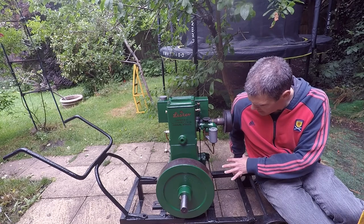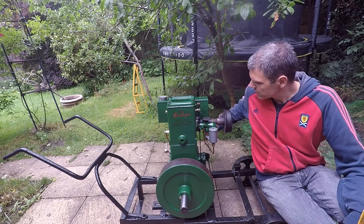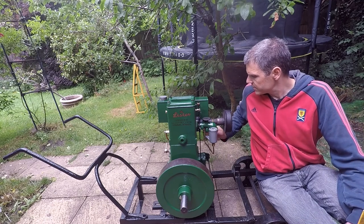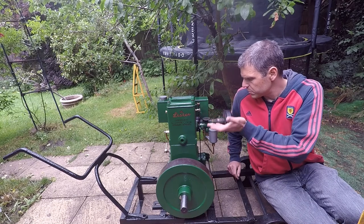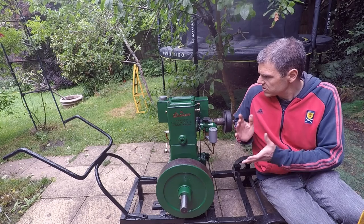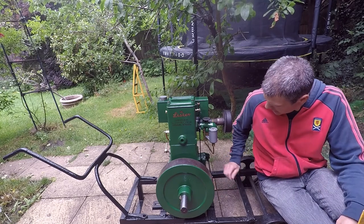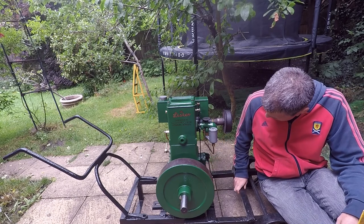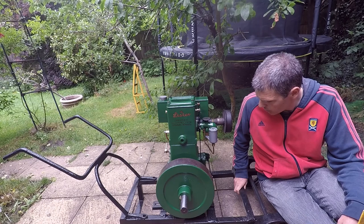So I've done all the pre-fire checks, so oiled everything, there are no fuel leaks. I checked that the fuel comes to the carb, put the needle, and I kind of greased the oilers. And obviously put oil inside the engine, as you do. So everything seems to be in order to commence